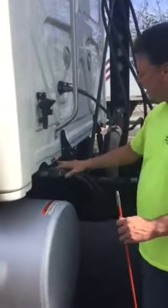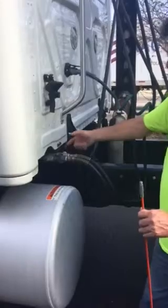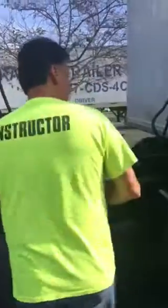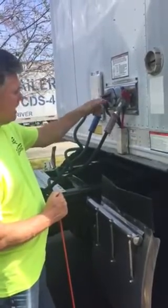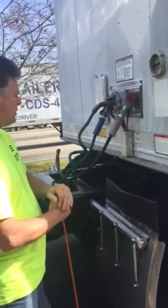Then I'll move to the tractor side of my air hoses. My airlines are not bent, cracked, or broken, missing nuts, bolts, or screws. My air hoses are not cut, cracked, dry rot, or frayed, and I hear no leaks. My glad hands on the trailer side are not bent, cracked, or broken, missing nuts, bolts, or screws, and I hear no leaks. To check them, I would simply remove the glad hand and look at the rubber grommet to make sure it's not cut, cracked, dry rot, or missing.